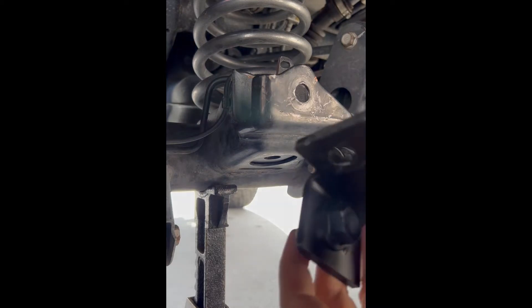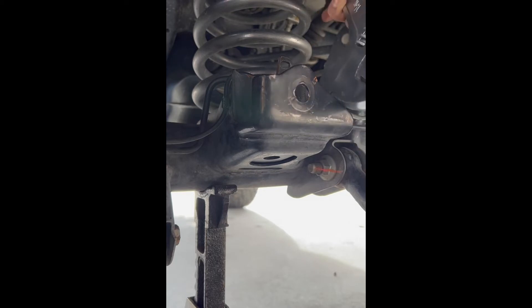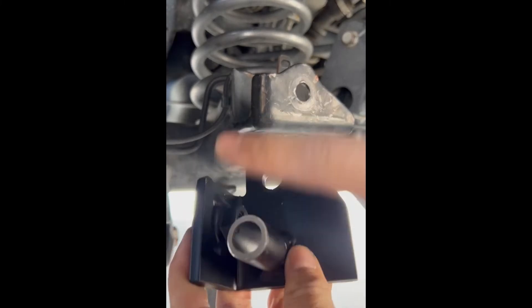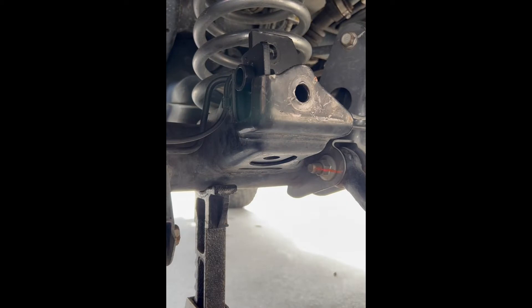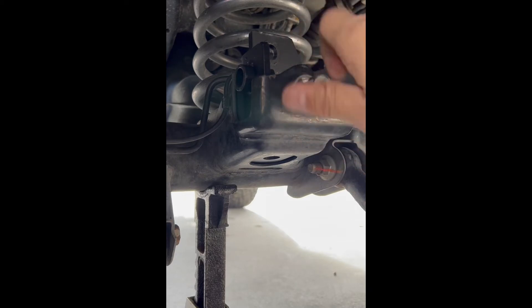This area here is going to be tight — it's a combination of the tight tolerance design with the powder coat and this being a little pinched from the factory to grip the factory panhard bar. You'll probably need a big crescent wrench and massage it open in every direction. Remove the powder coat from here if needed, or even grind it down a little. Fit it in until you can get the factory bolt threads going easily.